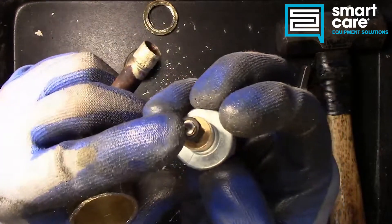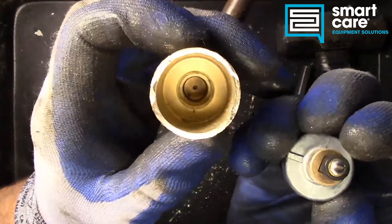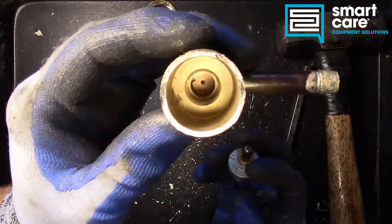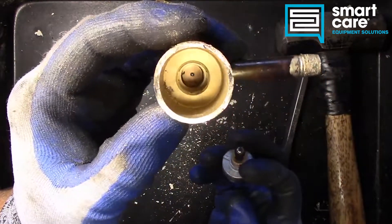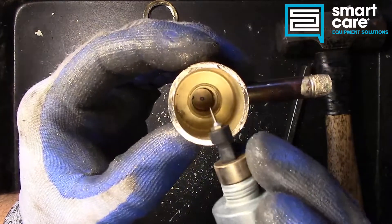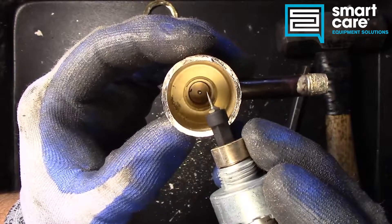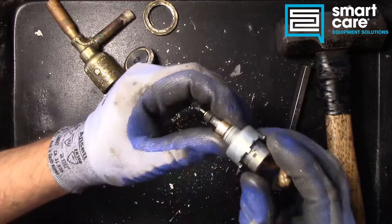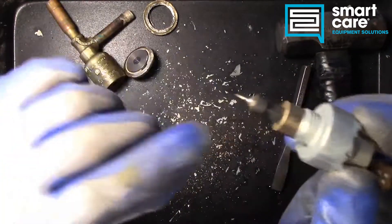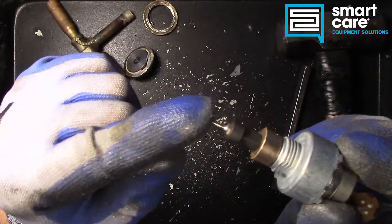There you can see the little pintle that actually goes down into the orifice, and that's our orifice way down inside there — that little small dot. In our system, the transition from high pressure to low pressure happens at that orifice. That little tiny dot down in there is where this little pintle opens and closes and rides inside. Now this assembly is all sealed up too, but we've got a movable shaft here with the little pintle pin in the end of it.